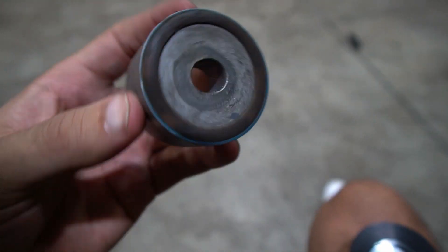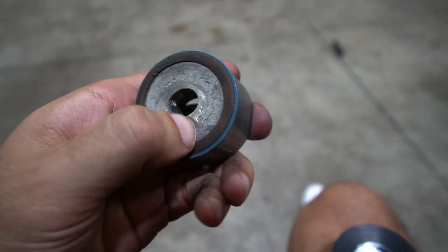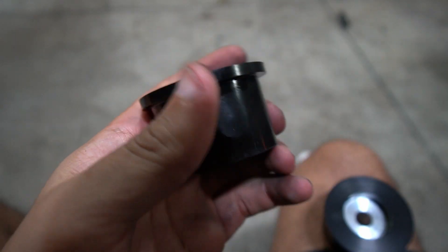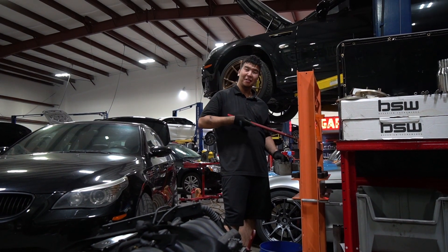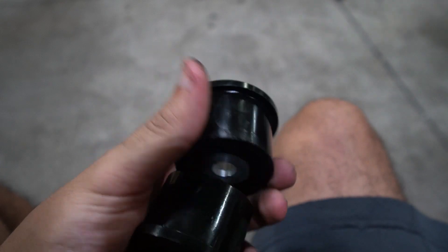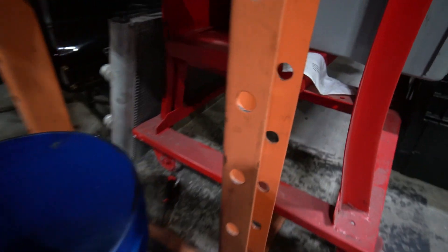As a comparison, here's the old bushing that Ali pressed out of the diff cover — pretty crusty, with a rubber and metal center. And here are the poly bushings from Rogue Engineering: metal center with very stiff polyurethane material on the outside. Much more durable — these should last the entire time Christian owns the E46 M3. The second old bushing pressed out looks even crustier than the first.